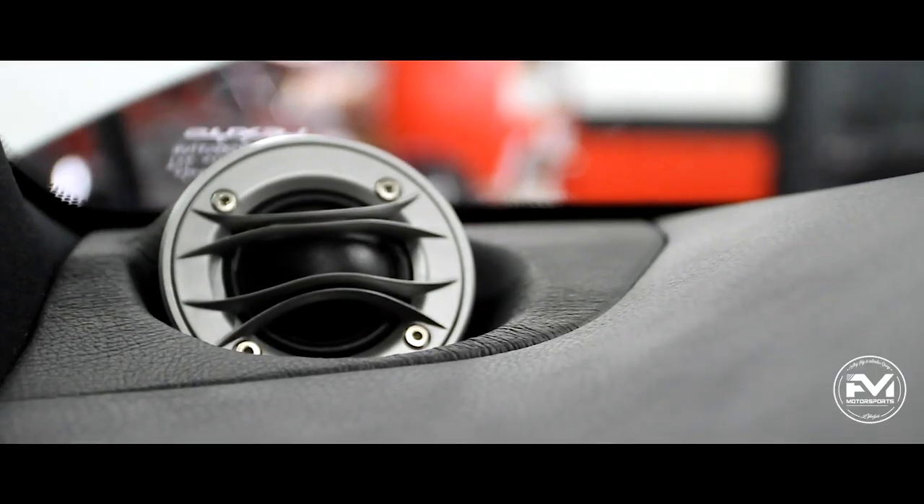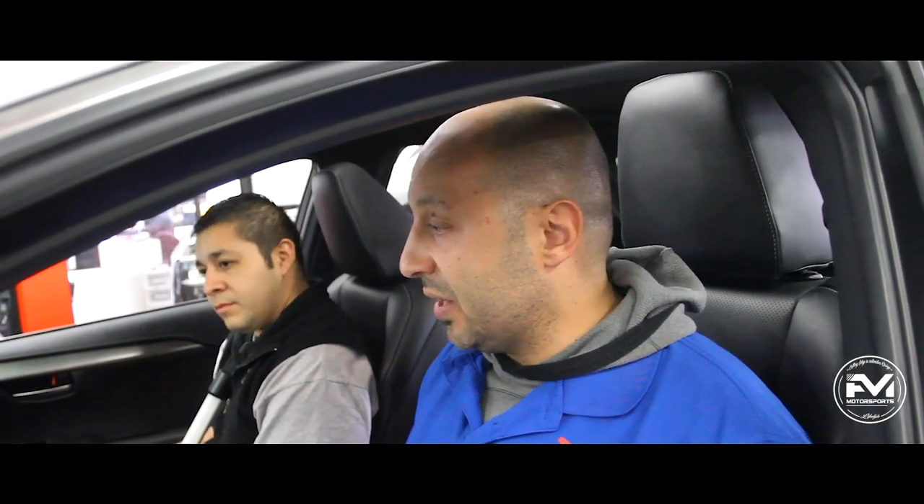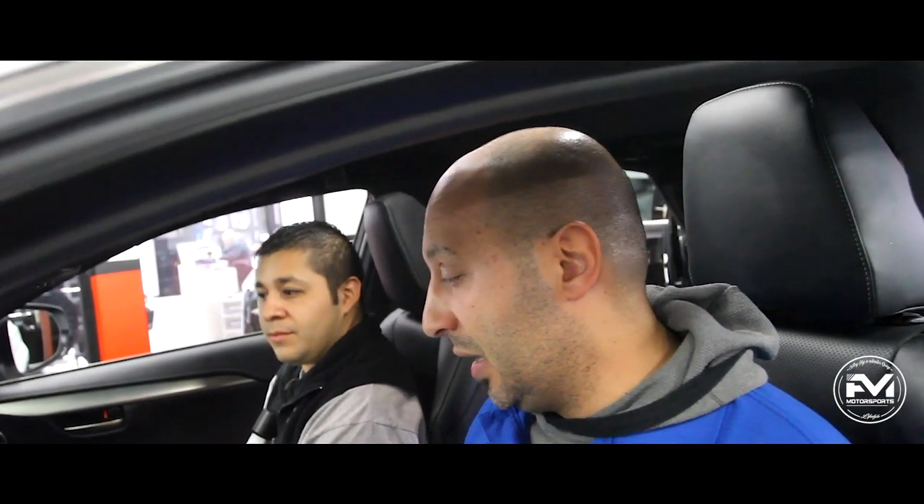This is George here at Fantasy Motorsports, Northridge location. Today we're showing you how we're going to set up the Bit One processor connected to the Voce amplifier, which is their signature line from Audison. We're installing the high-end Thesis speaker line from Audison and going fully active — running the tweeters on a separate channel from the six-and-a-half mid driver. We're actually going beyond the rated power: the speakers are rated at 150 watts RMS, but today with the Quattro amplifier we'll be providing each speaker independently 400 watts individually. We did this setup before and it sounds phenomenal. We're going to show you how to set up the Bit One processor and get it dialed in as a front staging system.